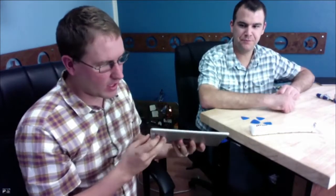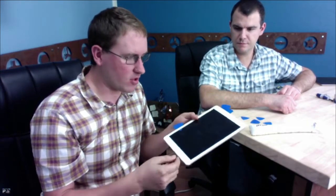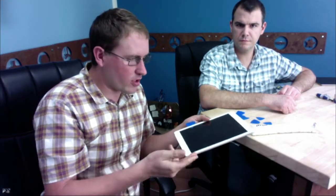So that's not what you're using today. It looks like big blue guitar picks. We have the guitar picks, and it's a process and patience. Don't rush it. The issue is you've got the glass on the outside, and the glass is very thin. The glass isn't glued to the LCD, but it's glued to the bezel all the way around. So you have to loosen it and work your way in. You're basically slicing the adhesive and working your way around.